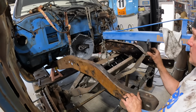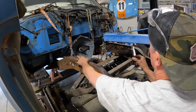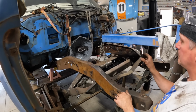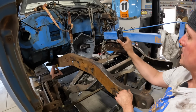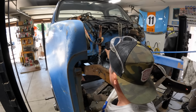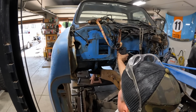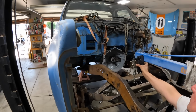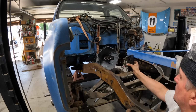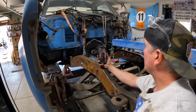Do you have the motor mounts cut out of that thing? Yeah, there's nothing. This was a 2-wheel drive, so this whole K-member just unbolted. We've got it back and we've got it up. This has an SM465 and then a 203, 205 doubler. So we've got the motor back a little bit and we've got it up a little bit. Right on. The truck has a lot of room, so you can cut that whole thing. You already got the firewall started cutting it out. Just keep on cutting.